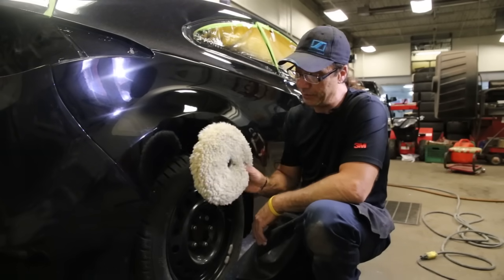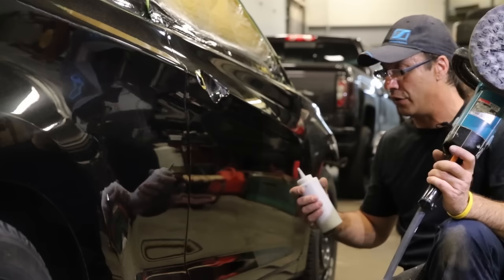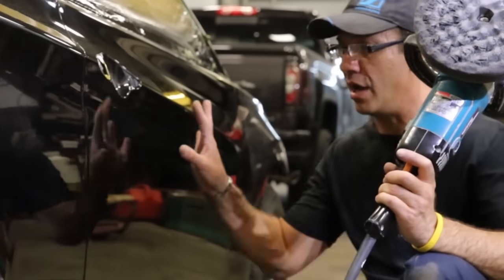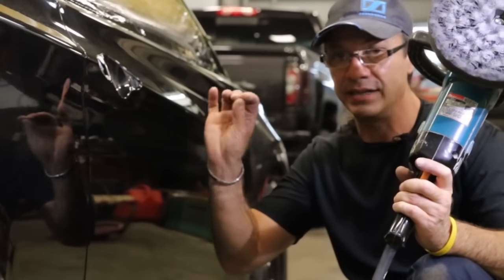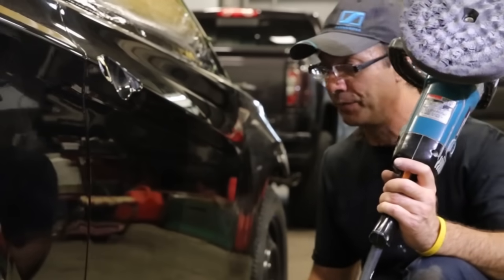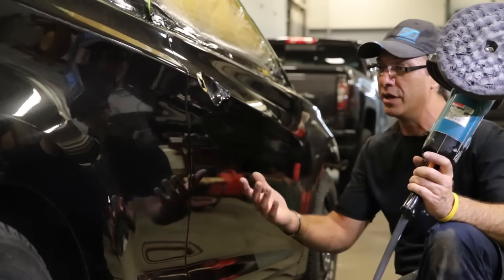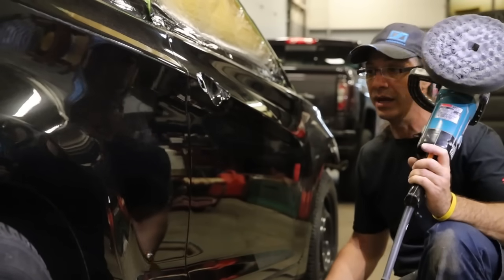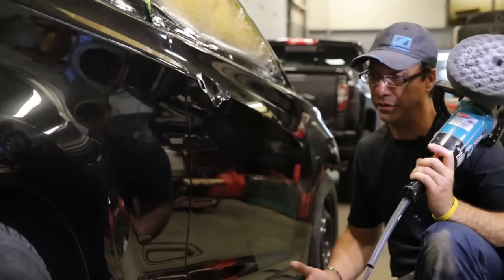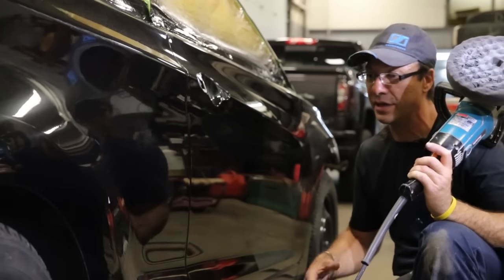These wool pads are the best — they're double sided, really nice. Every painter out there has a different system and all the surfaces look totally different. If you've got a guy who's always laying down clear that's really super tight and you just try to knock it off like I did, it's going to create tiny little pits. So you'd basically have to go totally flat with it, then you have to worry about your edges and burning through things. Always communicate with the painter and let him know if the peel is really tight. You either leave it or go totally flat — you can't go halfway. You'll live and learn; you'll start practicing and seeing different ways.